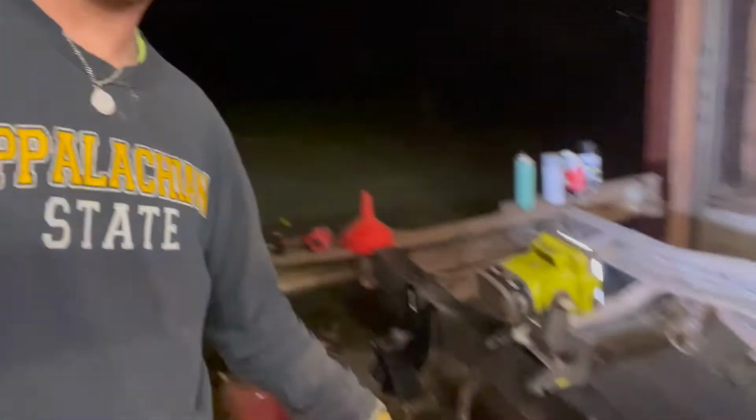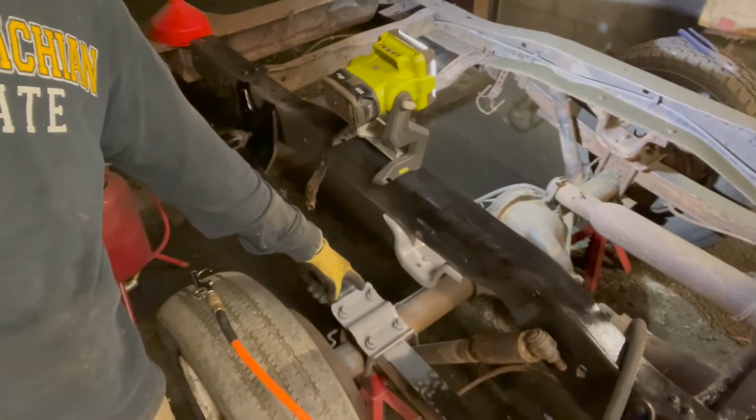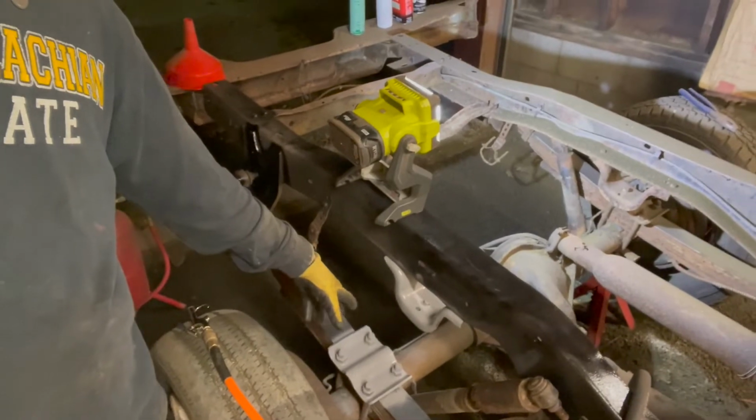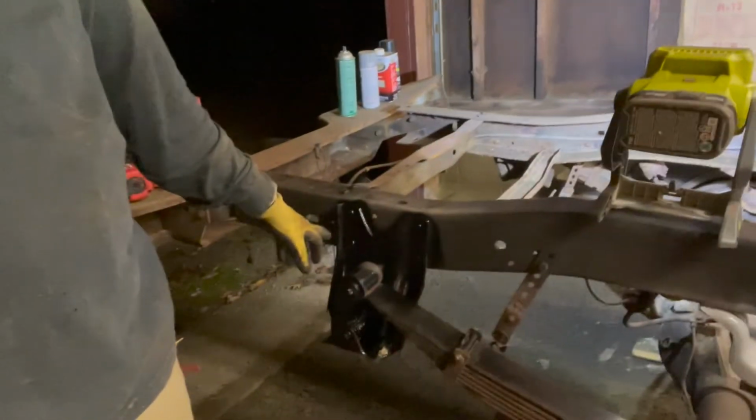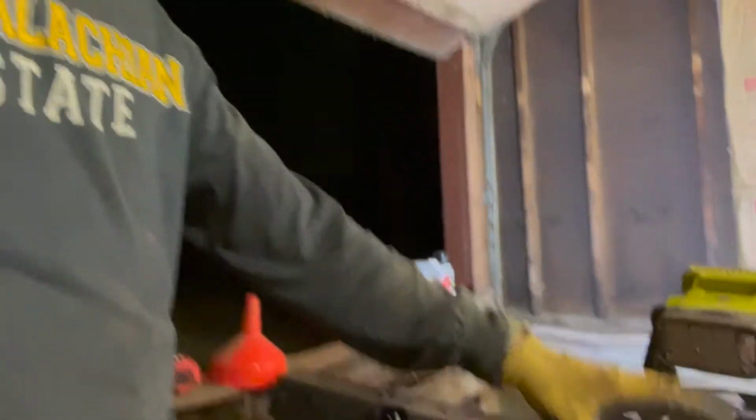I've used one of the ones where you stick your hands in the gloves and the compartment for it, but I've never used an open, portable one like this. And I've got to say, it worked quite well. I was able to clean up the bracket that holds the leaf springs onto the rear axle, the little bump stop on there for the frame, and the rear shackle back here. That all sanded or blasted up pretty easily, probably about 20 minutes.